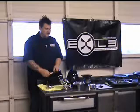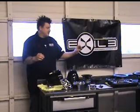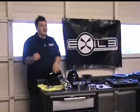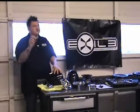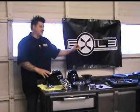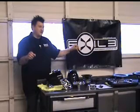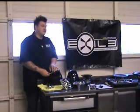There are two standards of power cable. You might see $1.15 a foot for 4-gauge and another at $3.99. The reason is the $3.99 is actual CEA-certified, meaning it's guaranteed to have a specific number of strands and is a true 4-gauge. The cheaper company doesn't have that certification, so that 4-gauge is actually an oversized jacket — which is cheaper than the copper inside — and it's actually less than true 4-gauge. Just because it's cheaper, you're not getting a bargain; you're actually decreasing what your amplifier can put out and not getting the full voltage.